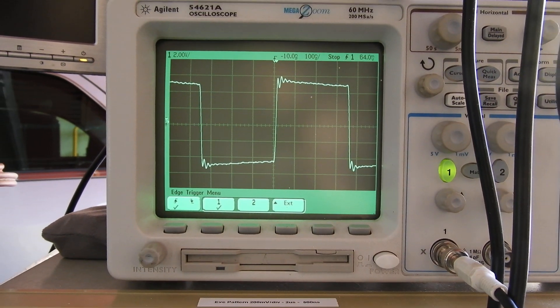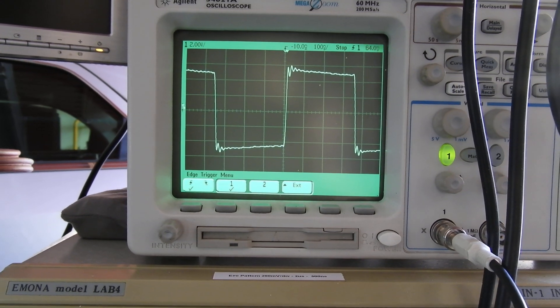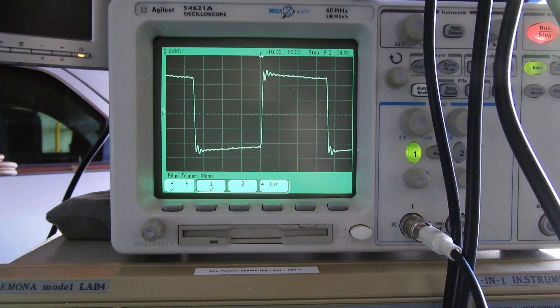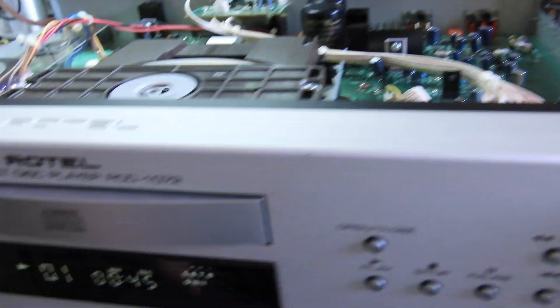It can be used as a transport. As you can see, it's a very nice square wave — a bit of ringing, very little overshoot — but the leading and trailing edges are rock solid, almost perfectly vertical.